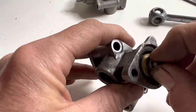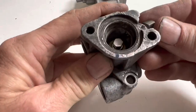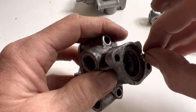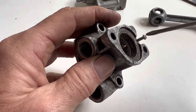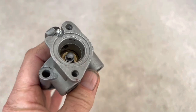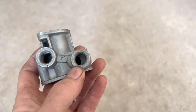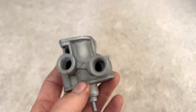This should just fit back in there, and then we just need to put the cam bolt on and screw it in — this will be ready to go back on the car. On earlier SLs the warm-up device or cold start valve — it has a number of different names — was purely mechanical. On later SLs the warm-up regulator or WUR has electrical connections.